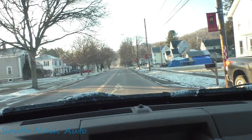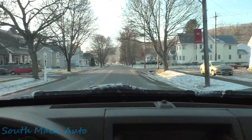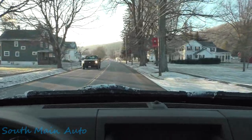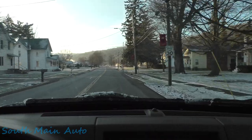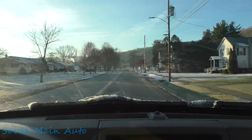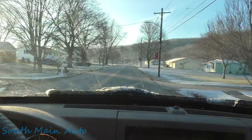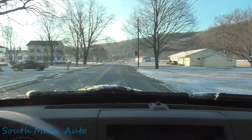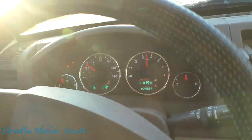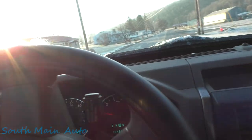There's an engine light and a tire light on it. Yep, the noise is obvious — that's off the throttle. That's on the throttle. No noise side to side. Fine knock. Let me put it in neutral. I put it in neutral — noise is still there. Oh, step on the brake and the noise goes away.